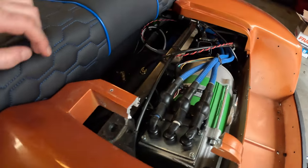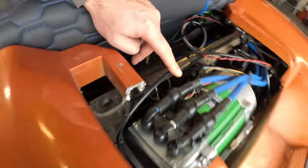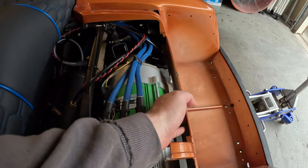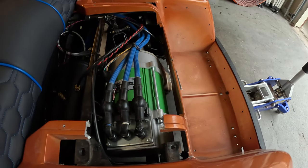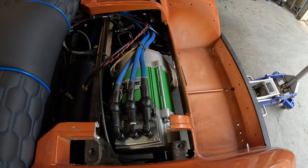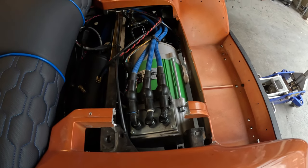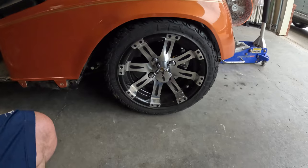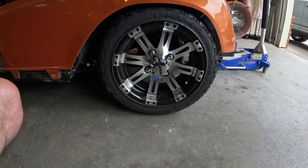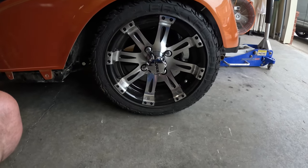I've got a fair amount of space to go forward, and when the bags are up the motor is dragging against the back of the body. So I'm going to jack the back end up and bring the axle forward probably a quarter to a half inch, and see where that gets us. Hopefully we'll be able to bring the wheel forward a little bit, center it up, and get a little more clearance back there.